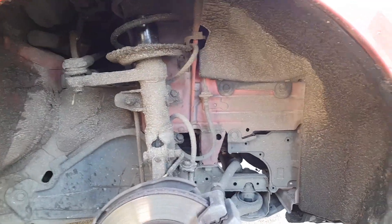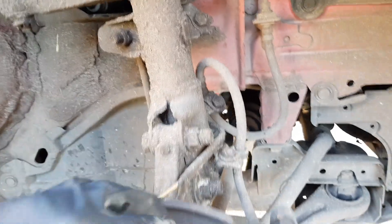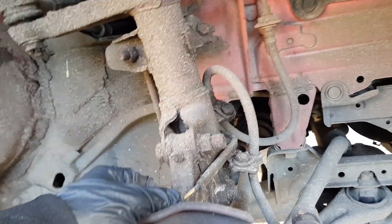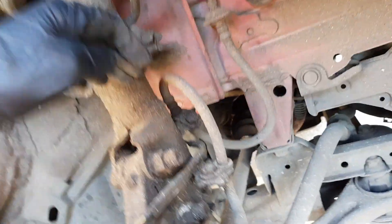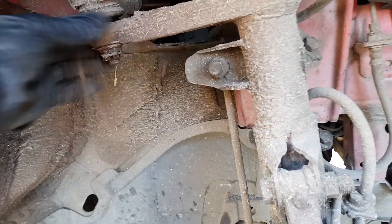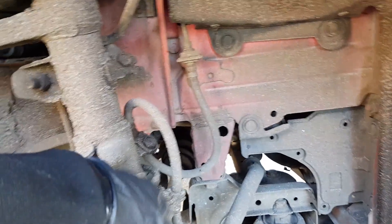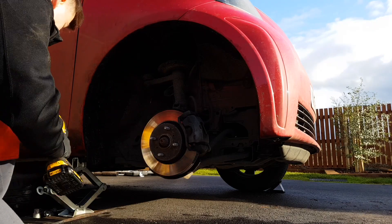So the front is going to be a little bit more complex. We've got these two we need to undo for the brake line — these two here. And another one here, this one here for the wheel speed sensor I believe. This one for the sway bar link and steering column. So there's quite a few. Hopefully them nuts are welded in on the other side and then there's obviously going to be a few up the top. So all them nuts are all 14s — so that's good.